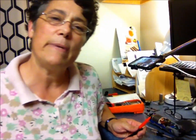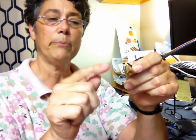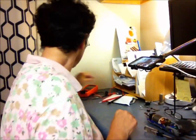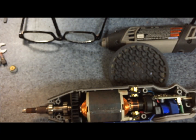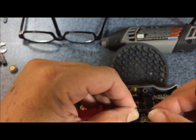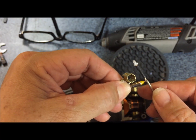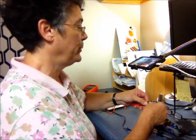I had a hunch that it overheated, so I bought a new part. This is the brush holder, and built into the brush holder is a thermal fuse that says: if this device gets too hot, I'm stopping — instead of igniting. So that's a pretty good deal. We're going to test this — I'll put one probe on one end and touch the other end. I got continuity. And just to prove it doesn't matter red or black, I'll switch them — same result. That means I've got electricity, a very small charge, passing through it.